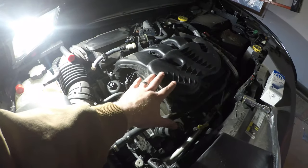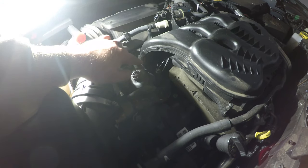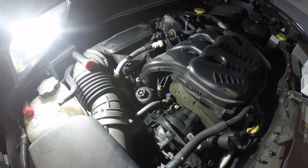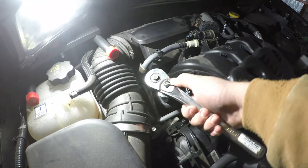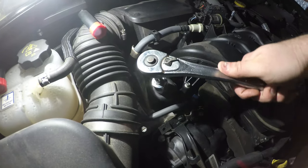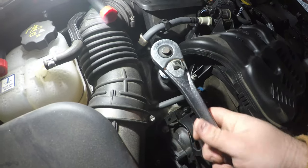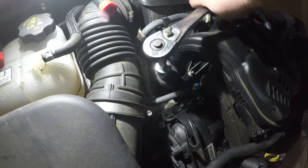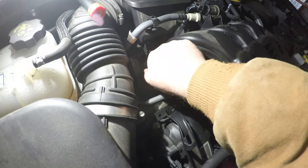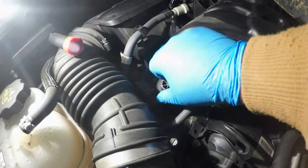This is where you'll find your oil filter underneath. Under the engine cover, you'll find the oil filter housing right here — it takes a 15/16th socket. I would be very careful taking it out because it is plastic. Take your ratchet and just crack it loose. You'll want a pan and a rag. When you go to put it back in, don't overtighten — it's just plastic into a plastic housing, you will break it. Let me get a pan and a rag and we'll pull this out the rest of the way.